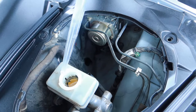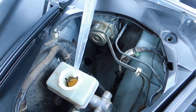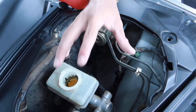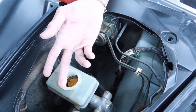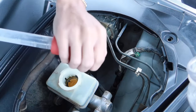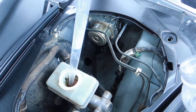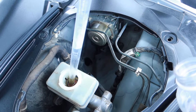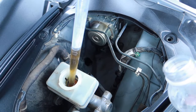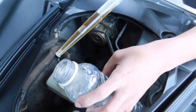With the cap and filter removed, go ahead and get your turkey baster and start taking out some fluid. You have to be extremely careful — once you let air inside this reservoir you are going to have to bleed the entire system, which we are trying to avoid. So we're going to take just enough fluid out so we don't let air in, then replace it with clean fluid, run it, and do the process again. Squeeze the turkey baster, put it inside the reservoir, and let it go ever so slowly.